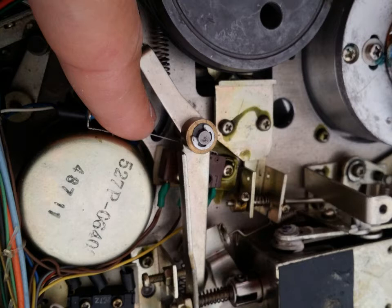I've also fixed an awful lot of stuff on this machine — springs, guides, you name it. There are little switches in the back of this unit that many people wouldn't even think about fixing. I had brand new ones to replace them with — thank God, because these are kind of hard to find. They were bad, so I ended up changing all those switches in the back, and there are also a couple hidden up at the very top. It's a very little micro switch with a lever on it. I had a whole tray of about 20 of these, very lucky. I got these for free many years ago, so I was glad I was able to use a few of them.